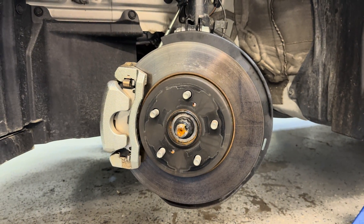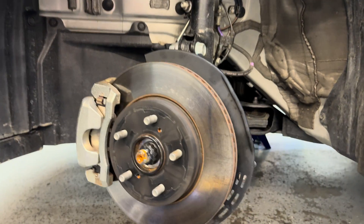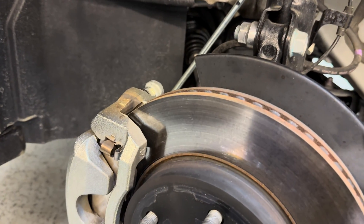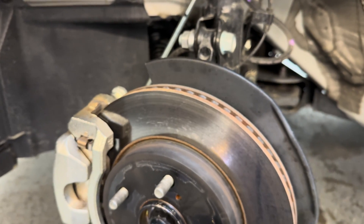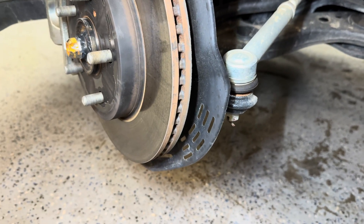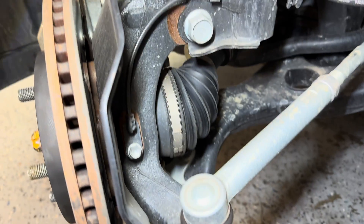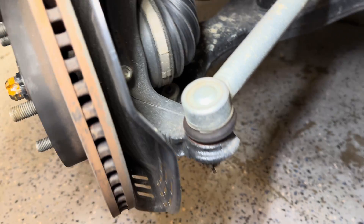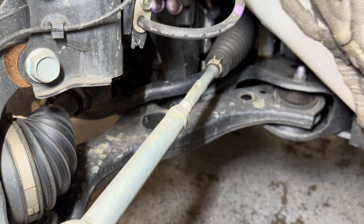A quick measure shows this rotor at just over 11 inches — looks like around 11.1 inches. With regen active on this Prius, it doesn't have a lot of wear even at 10,000 miles, and is pretty smooth, almost close to factory finish. On the back side of the rotor we see this brake dust shield that has some cooling vanes on the bottom, and right behind that we see the other side of the upright with the ABS speed sensor installed directly into it, along with the tie rod connection going back to the steering rack.